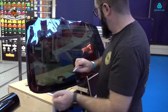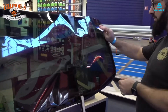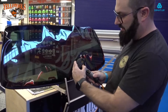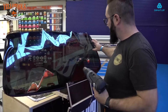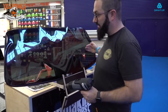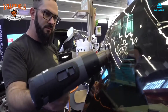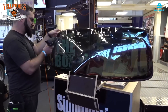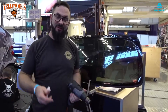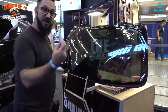Up and down, and also the right side — only in the middle, up and down. I use my heat gun, not as hot — around setting six — and put the heat directly in this area, moving slowly up and slowly down. I don't really need a squeegee right now because the film sticks directly to the window when I shrink it, so it cannot move. If you want to use a squeegee, you can use it now.